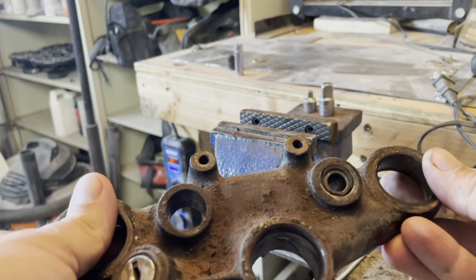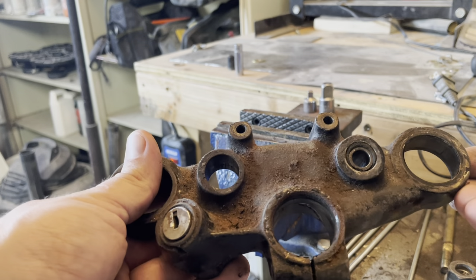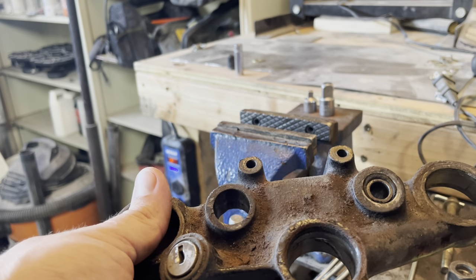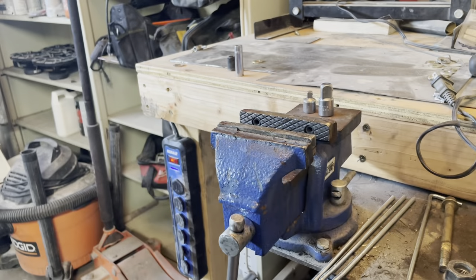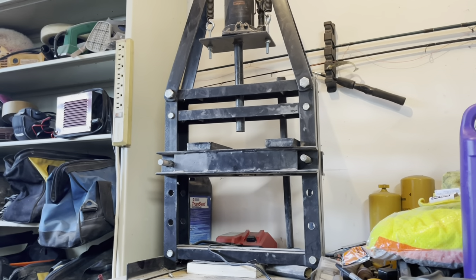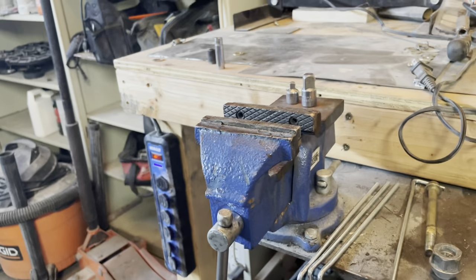What I'm trying to do — you can see I already did one — but it has these handlebar bushings here, and I tried to hit them out with a socket as you usually would, and it didn't really seem to budge them. I ended up using this press here to press the first one out, but I think there's another way to do it without a press, and I wanted to show that to you.